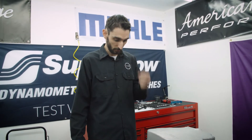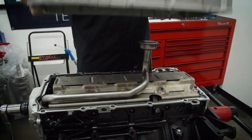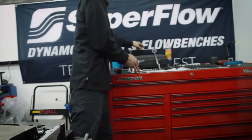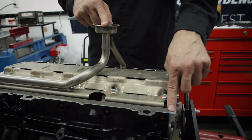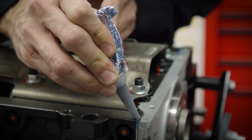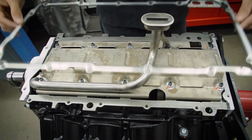Place it on there — if it looks good and bolt holes are lining up, you know everything's going to work out. Go ahead and pull it off again and remove the gasket. Now, for extra insurance, take a little dab of silicone at the two mating areas: where the pan rail meets the rear cover and where it meets the front cover — those two gasket junction marks.